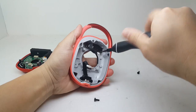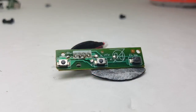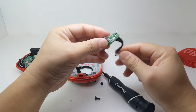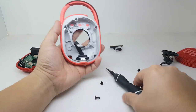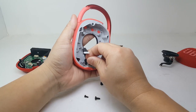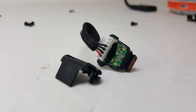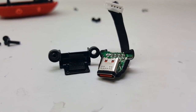Next let's remove these two screws to take off the circuit board for the front buttons. The circuit board contains the play and the volume up and down buttons. Now let's remove the charging port by removing this black cover, which reveals the charging board that we can just pull right off. The charging port is upgraded to USB-C instead of the micro USB on the Clip 3, giving you a charge time of three hours.